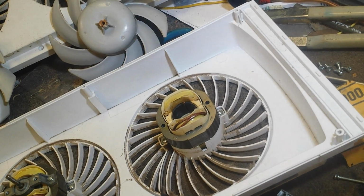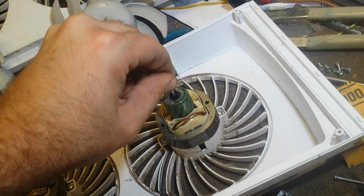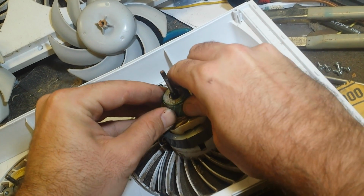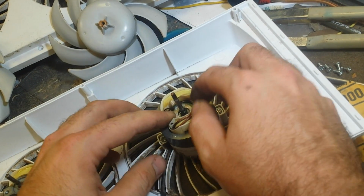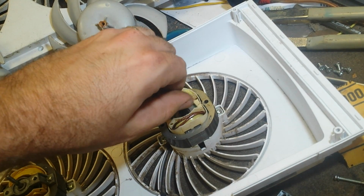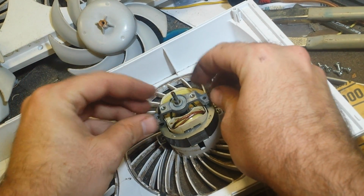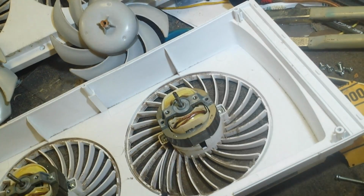You'll have to excuse my makeshift camera stand there. So now we're going to sink this inside, very carefully working it back in because this shitty plastic housing's warped. Love working with crappy products. Little washer popped off in my hand. Make sure that's seated and it rotates freely. And then we're going to put the top bearing back on. Goes on nice and smooth now. Seat that.